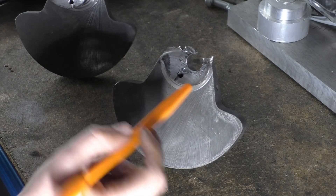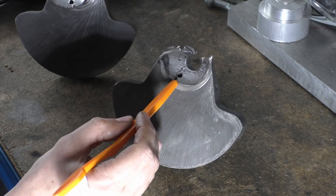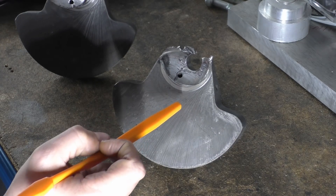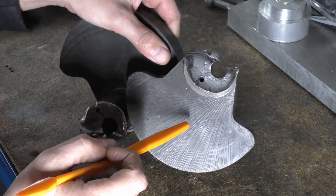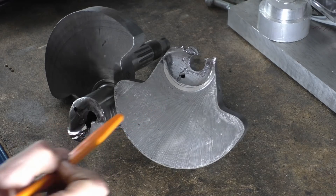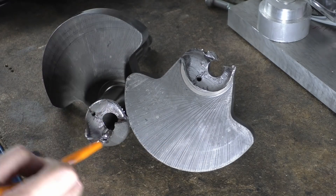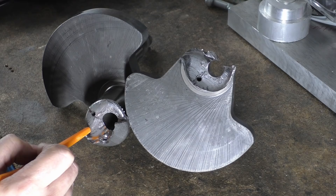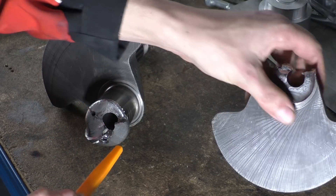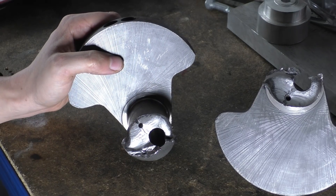The cross drilling makes this just the thinnest part, so if we were to expect this to fail, we'd expect it to fail there. Unluckily for this guy's bike it did exactly that, and when this let go it would have been absolutely horrible. This is a strong piece of steel, but this just shows you some of the forces we're playing with when we go to higher horsepower — it's a wing and a prayer.